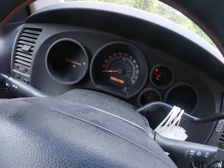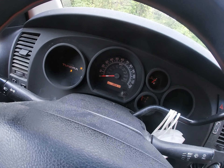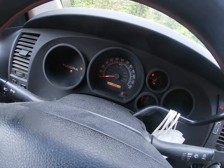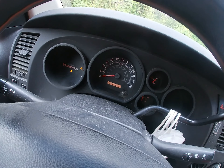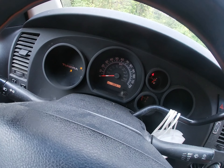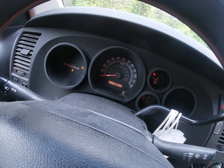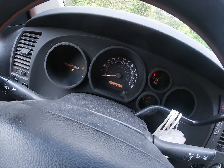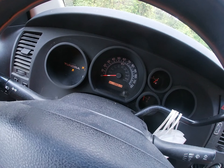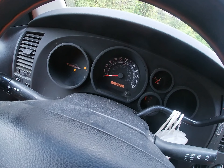When you got a bad air pump, that air pump is actually pushing air to the catalytic converter, pushing air there to make the gas flow faster so the engine can reach a normal temperature. The problem is when these air pumps start sucking in a little water, accumulation of water from condensation. This makes the valves get stuck. That's what I got now - a stuck valve.